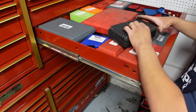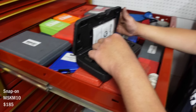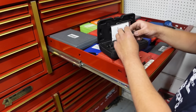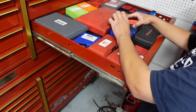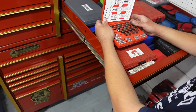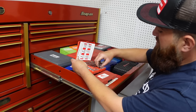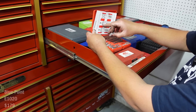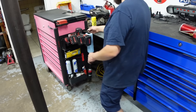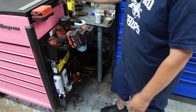Stud pullers — this stud puller from Snap-on is just my favorite. The metric one. You put it on the stud and it jams on so you can drive the stud in without it just spinning. And this bolt extractor — I actually used this about a month ago on a Blazer. The guy did his own water pump, broke one of the bolts off, said it'd be fine, then it started leaking. These are cool because they come with guides you jam in the hole that tells you what bit to use to drill flush. I drilled through, jammed it in, and just walked it out.